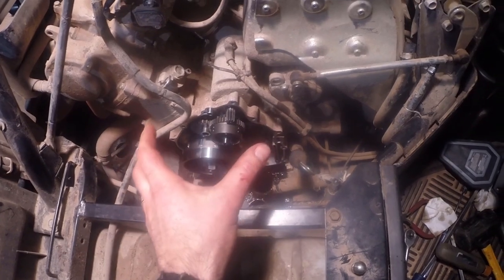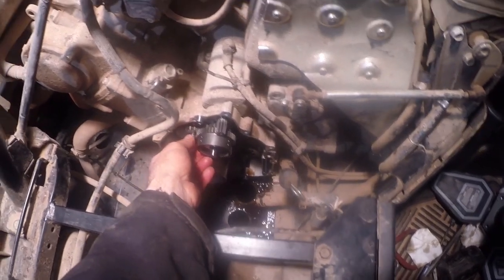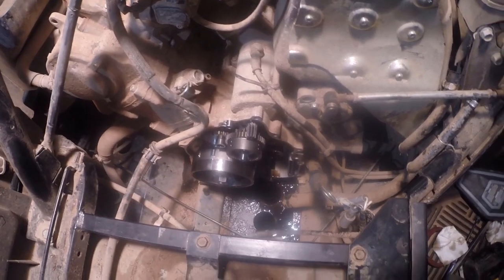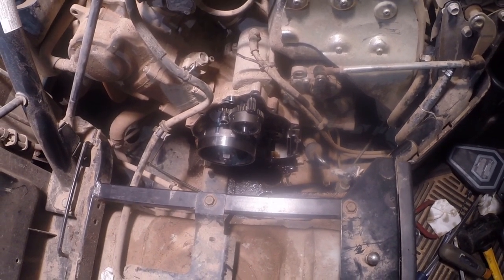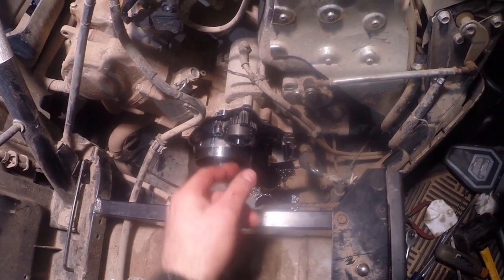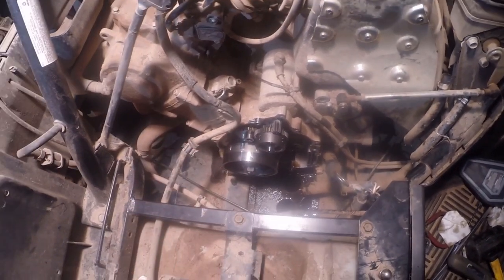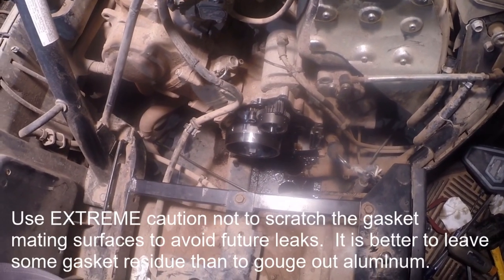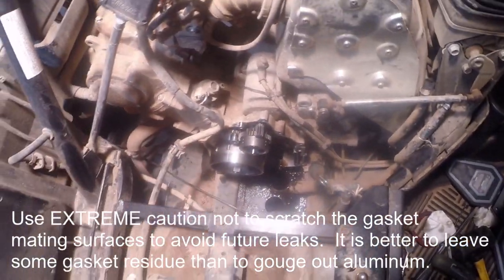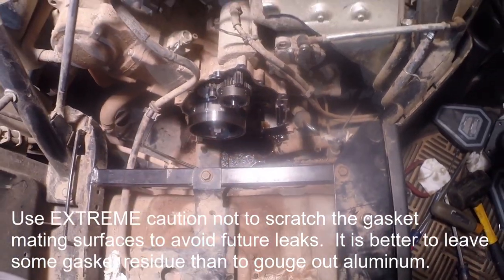There's a dowel here and a dowel down at the bottom. We're going to take the gasket and put it on those dowels. You'll notice these gears are all pushed towards the engine - that's great. You don't need to have case bolts in your hands when you're trying to reinstall because it will self-center on these dowels, and the magnetic force of the rotor is probably going to suck the cover in anyway. Make sure there isn't any leftover gasket - we've had quite a time scraping all the gasket surfaces on both the cover and the block.